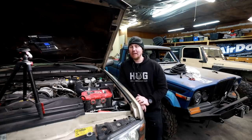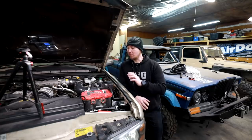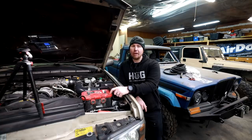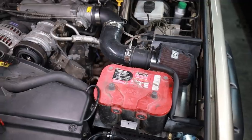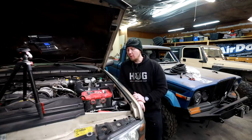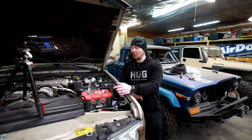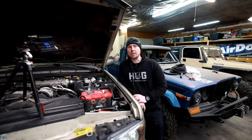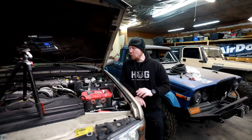I'm going to have to address this at some point and build it the right way because I do like to travel out of state to dry places. I know a lot of you are yelling at your computers — why didn't he just move the battery and build it right? Hindsight's 20/20. What I should have done is located the battery somewhere else — you can mount these sideways, put it in the back, whatever — and that would have made a lot more sense. For now we're going to hook up this battery as it sits. In the future when I build the real intake, I'll build a nice heavy-duty intake box with a panel filter and build a snorkel from scratch — there's some stuff you can do to make a snorkel pretty awesome without using PVC pipe. We'll probably build it out of fiberglass, and that'll be the future video.